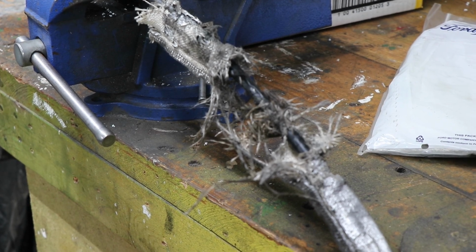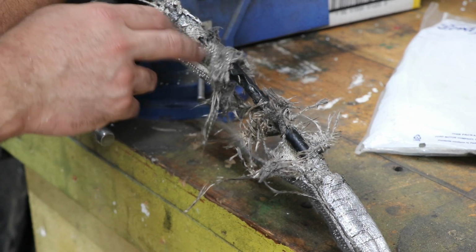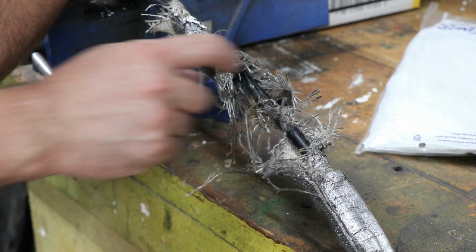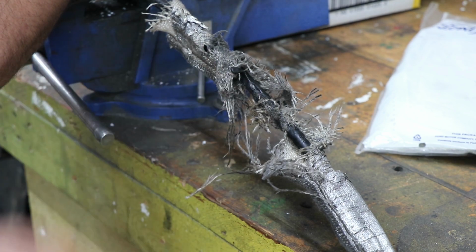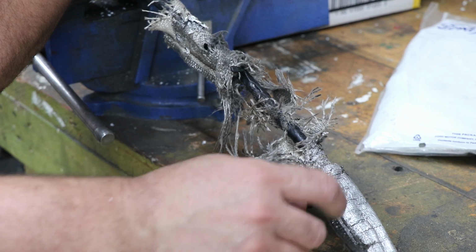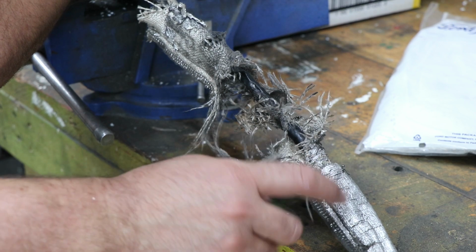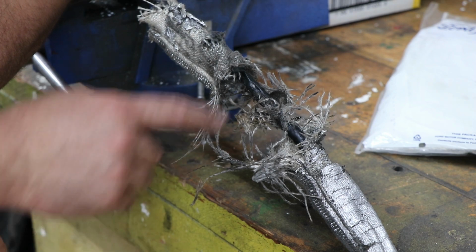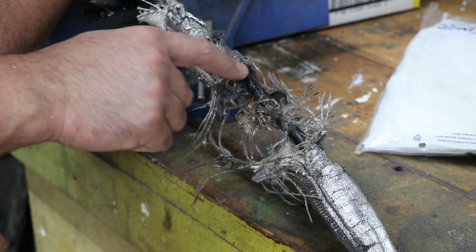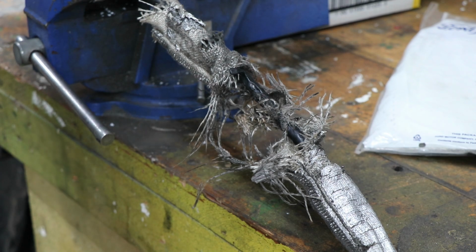And this is why I took everything apart. Just because of the way things work out, this clutch cable is sandwiched between a header tube and the oil pan, so obviously it sees a lot of heat. The first time I had a problem with this was when I went out to Colorado, after which I added this DEI aluminized heat shielding, and I've had to change this stuff out every once in a while when I've had the engine and transmission out. But as you can see, it wore through and it's melted, and it's probably why I was getting a little bit of a funky feeling clutch pedal.